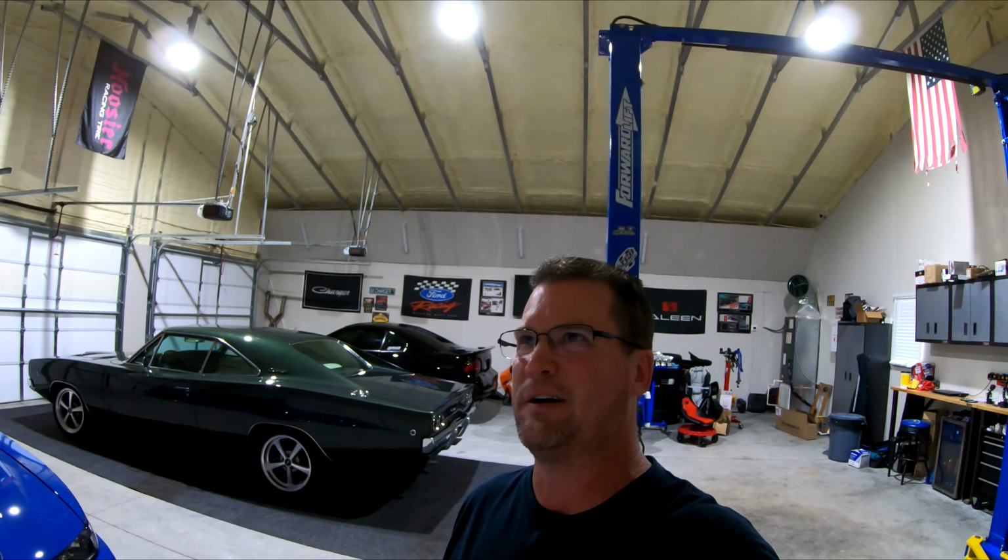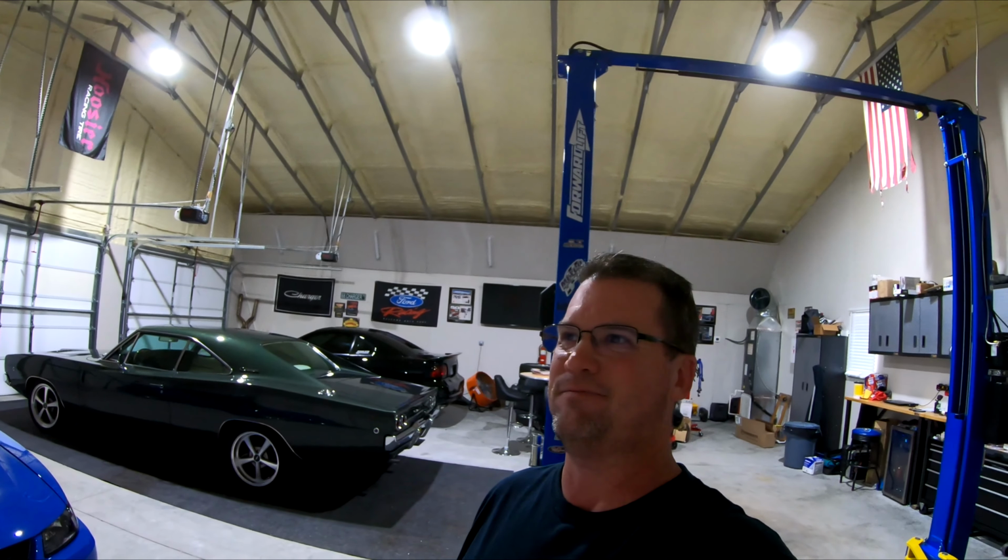So I've had the truck 12 years, and I guess about every 6 years or so, the muffler starts going out, and it's just the moisture gets in there and basically blows the baffles out of it. It starts getting really loud, and the first muffler would rattle and all that. This muffler's not rattling, it's just kind of extra loud now, kind of aggressive,